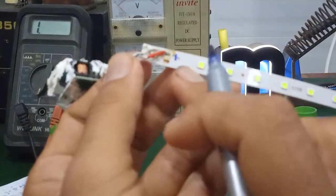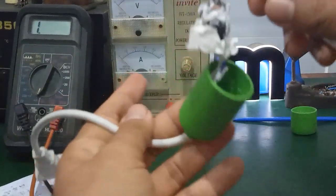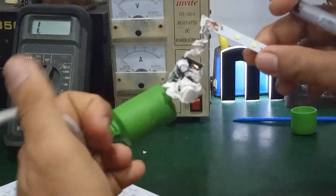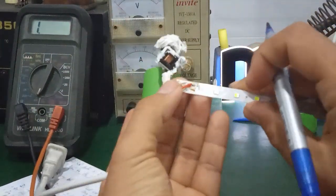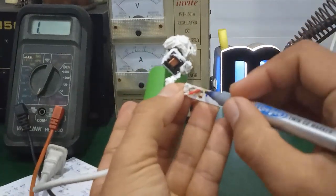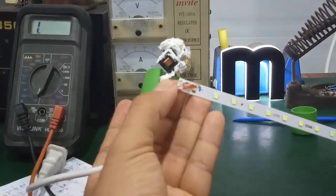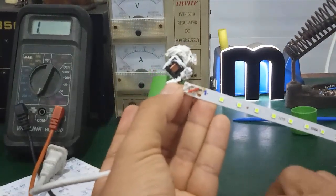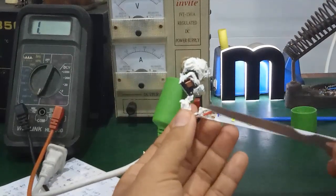In the middle at the bottom there is an AC line, but since this lamp uses a direct plug-in connection rather than a ballast, we will not use the AC line at the bottom. You only need to pay attention to the positive and negative lines. When doing repairs, you can mark the wires or use some notation so you reconnect them correctly.